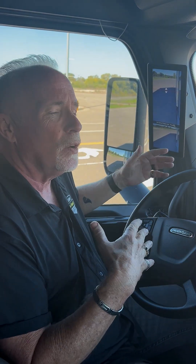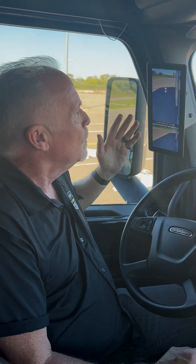Right now what I'm going to do is show you how to adjust the distance lines. Not all trailers are the same length — you got 45, 48, 53. You can adjust the lines on this so you can know where the back of your trailer is. It's very important on this system to understand where the back of your trailer is, because remember you're not dealing with a 3D image in your eyeballs now — it's a 2D image.